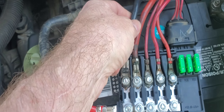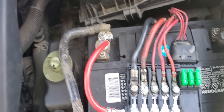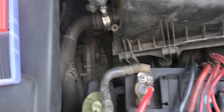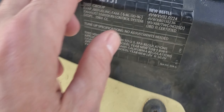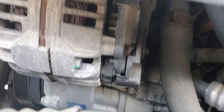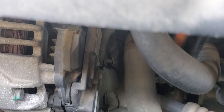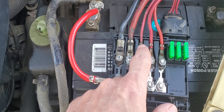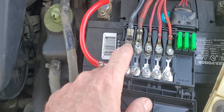I'm pretty sure this is a 6-gauge and the one that I ordered is a 4-gauge. I got a 4-foot cable — I'm just going to sneak it around down through here, then it connects to the alternator right there. That's my solution. Right now I'm just going to unhook all this and start stripping these wires back.